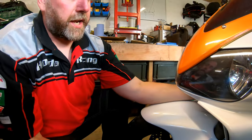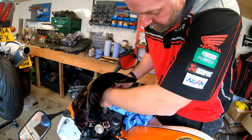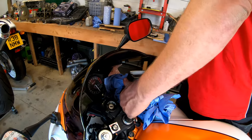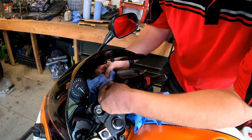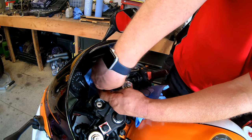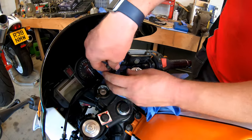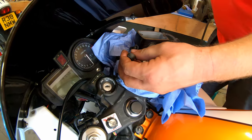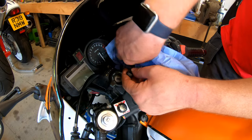That is the line completely free from the bike with the exception of the banjo at the master cylinder, so that's where we're going next. As before, make sure there is plenty of paper there, and then we can crack the banjo off the master cylinder. That one is a bit tighter than the other two. Pull the banjo out - and there we go. Just make sure there's not much dripping, which there isn't. I'm just going to be doubly sure with paper.